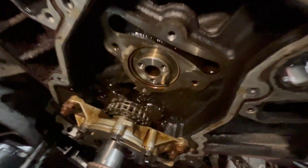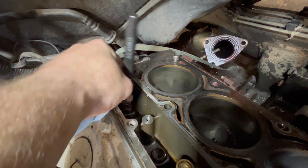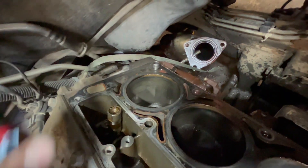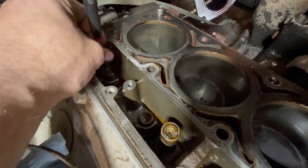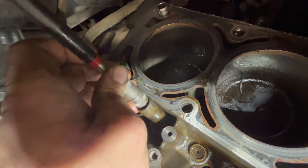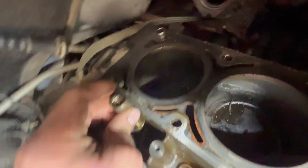We've got all the lifter trays out, lifters are still in, and we're ready to pull the cam. We're going to pull number seven's lifters first for fun - if they'll come out. Sometimes they will not come out because they're so damaged. Here is one of them trying to come out - we've got one there. Let's inspect its lobe. That's the good one that came out, so the farthest one in the back probably won't cooperate.